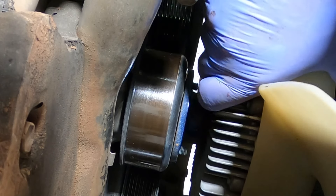Mating surface all cleaned up where the gasket goes on all faces — time to install the water pump. By taking those studs out the water pump fits in relatively easily. Start a couple of bolts to hold it in place. Thermostat is oriented the right way with the vent side up. It appears the long bolts have RTV on their threads and the short bolts do not, so I'll do the exact same when putting this back together.